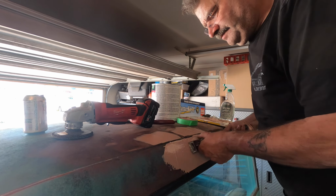That sure is tiger striping. It's kind of real heavy on the bottom of the spray and then not so heavy on the top. Okay, so I started to scratch her up with one of these guys here. I find it a little bit too aggressive because we're not really trying to remove material. All we're really looking to do is take away that gloss finish. Now, I think the best way to do that is this sandpaper here. I got some 1000 and some 2000 grit. So I'm gonna spray some soapy water down and hit it with those, and we'll go from there.